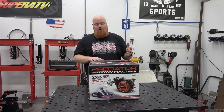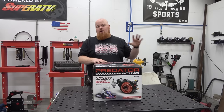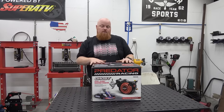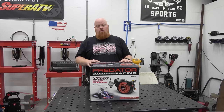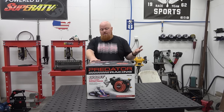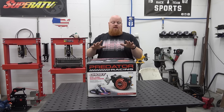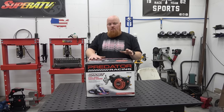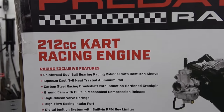This was designed around kart racing and asphalt racing — that's what this whole engine was built around. There is an accessory kit we'll talk about in a different video that's fully designed for a race car chassis. We're going to be using this on a mini bike, so we won't need that accessory kit. Let's get this unboxed. It's a smaller box because it does not have a gas tank or exhaust. With just the engine, the only thing you get is a carburetor — not even an air filter.